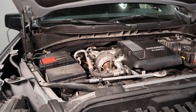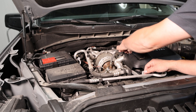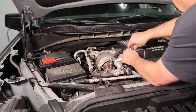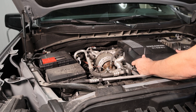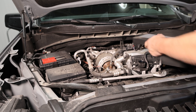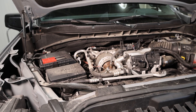The next step, once the battery is disconnected, is to take the engine cover off. This is super simple — there's one 10mm bolt right here on the passenger side of that cover. We're going to loosen up that bolt and then remove our oil cap so we can get in there. We've got the bolt loose. We remove the cap, set it aside, and then you can lift up on the front of that cover and pull it towards you. It's got a couple of isolators that hold it in the back, so you just have to slide it forward off of that cover. Now we have our harness and module out of our package.